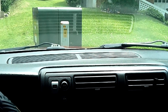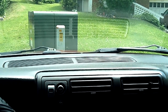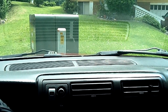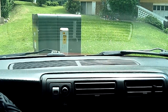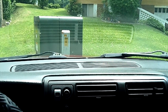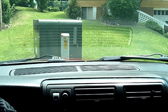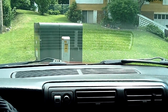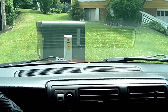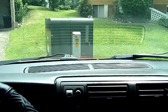This is a two-door model, so under my seat would be the cross member that the torsion bar is actually connected to — the rear of the torsion bars. They have these little links that look almost like a stabilizer bar or sway bar link. There are two little metal links with bushings on each side and a screw that goes through. That's what mounts the actual torsion bar support beam across the frame, across the vehicle. And I think that's where my noise is coming from.